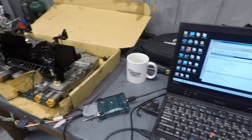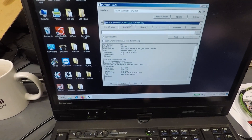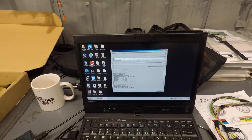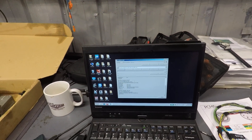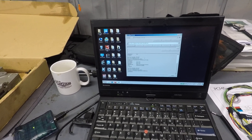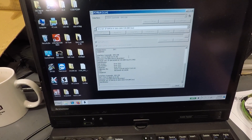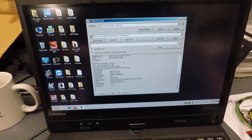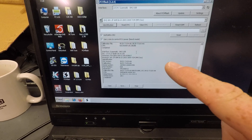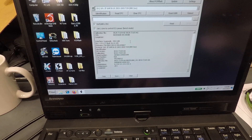So just imagine right now we're connected via OBD, like we've plugged into the car. So it's on the bench, but we're doing this as OBD version — this is the OBD protocol. We can go to identification and it takes some seconds, maybe 5 to 10 seconds, to interrogate the TCM. And then we will get all of the information out that is relevant. Boom — there it is. So this TCM, we can see software versions. That's the strategy and the calibration file, the serial number, part number, hardware number, CVN, and also the adaptations here.